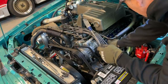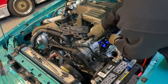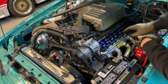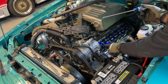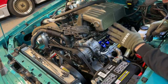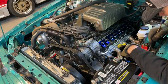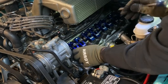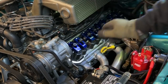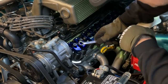So far I don't feel anything that's too tight, so this isn't looking too promising, to be completely honest with you. The first thing you want to do is spin the engine over — start on either end — and you'll see these rocker arms start to move. You want to make sure it's on the base circle, meaning it has some play in it. Starting right here on this one — this particular rocker arm is on the base circle, meaning it's not on a lobe on the camshaft.